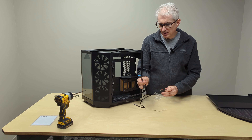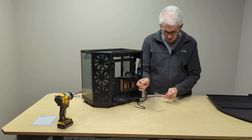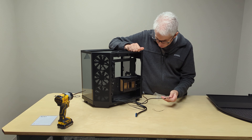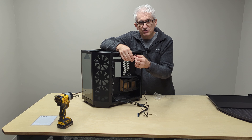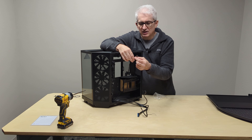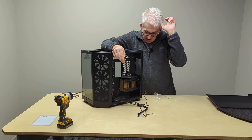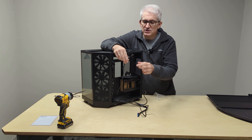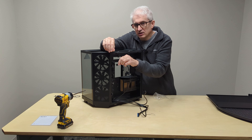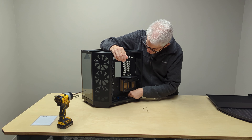You've got USB 3.0 in the front that you plug into the motherboard. We've got HD audio, which is front audio basically. Then we've got the front power button, reset switch, and power LED. What I like is this is all integrated into one plug — I don't know why more companies aren't doing this. It's actually fairly rare still to see. NZXT is doing it on all their flow cases, and it's just one plug instead of dealing with each of these wires separately.